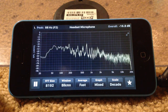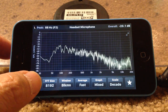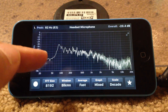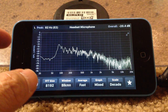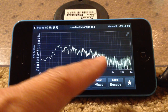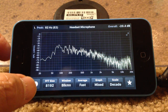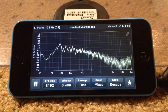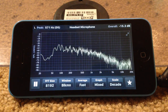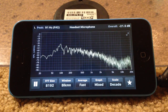Let's go back to the Sony SRS-S5. You can see it really starts to drop off between maybe 60 to 75 Hz. It's nice and fairly flat in the mid-range and has a tiny little bump in the treble range because the sound feature is on. Let's turn off the sound feature — you can see the treble dropped off a little. Turning the sound feature back on, it has a nice little boost up there.